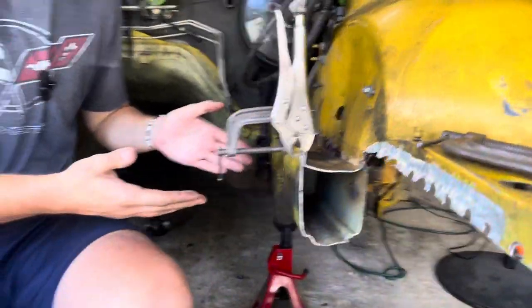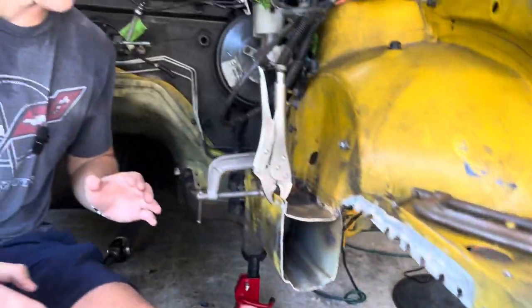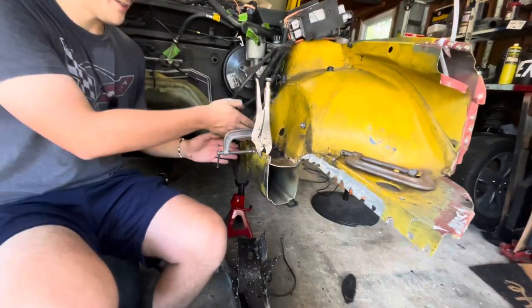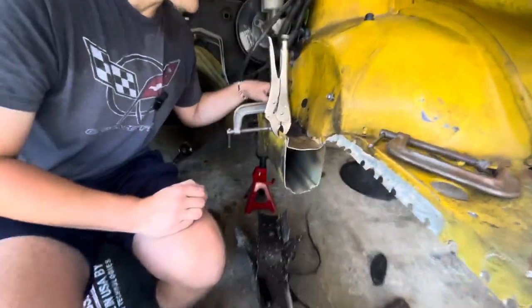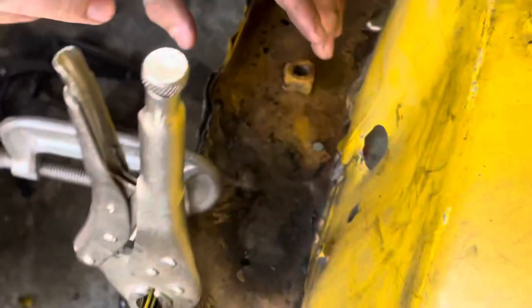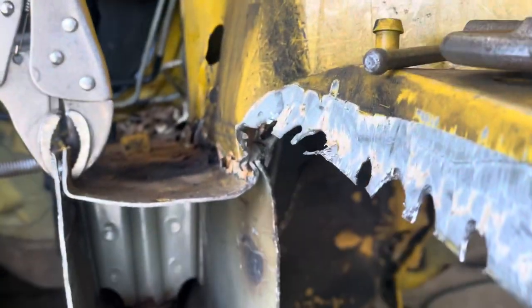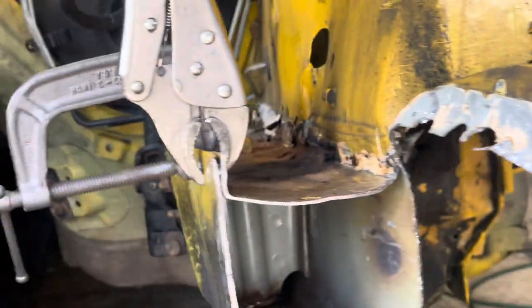Last time you guys saw this frame rail, and it might have been hard to see in the time lapse because it was a very quick moving time lapse. We got a lot of that kink worked out. The majority of it was right in this area. And Mike, if you come closer, you can see this whole area used to be kinked. This was all bad. Now we got it pretty good, right? A lot better than it was. These spot welds line back up out here.